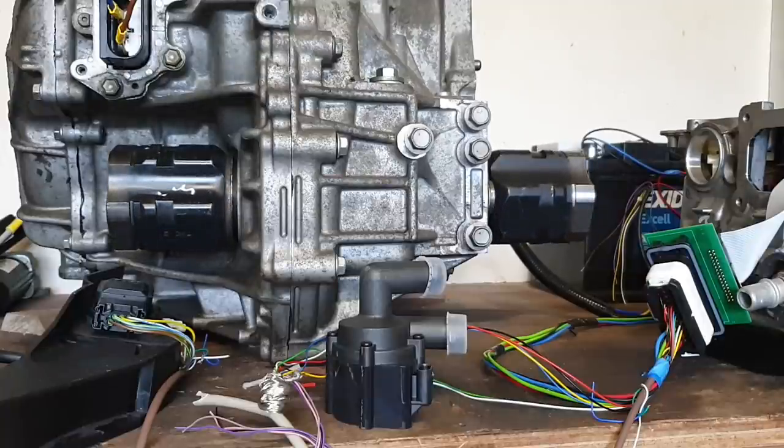Back to my parameters. And I'm going to start going up in maybe 200. So I'm going to go to 9,900. And 3 amps, 6 amps, 12 amps, nothing at 12 amps, 25 amps, 50 amps, okay, very good, 70 amps, 100 amps, okay, do you see that and hear that? We're vibrating here, okay, and back to zero.